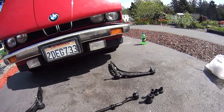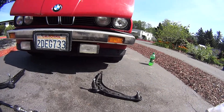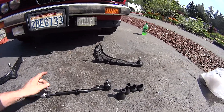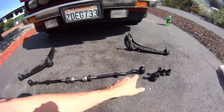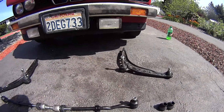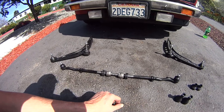I'm going to jack that tire up after I get the nuts loosened up on the wheel, take that tire off, and get prepared to take the control arm off on this side and replace it. These also came with protective boots to keep things from getting damaged in transport. Should be a straightforward fix.